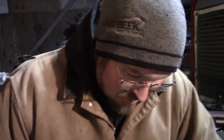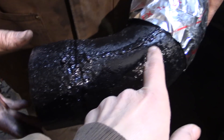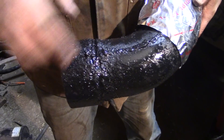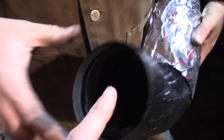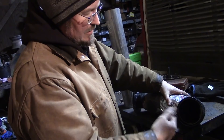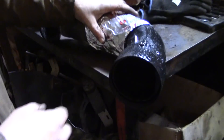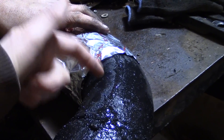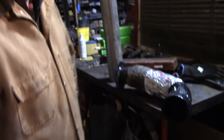New word: 'bumbly weld.' He also laid a new bead on a spot that was split. You can see the piece he cut in. Some might say that's an air restriction, but it's not — it's the same size, the same line as the pipe coming out. It's just a slightly wider collar to fit over it — a pinch fix. He also had to re-tape some of the heat shield.